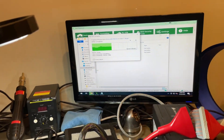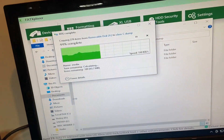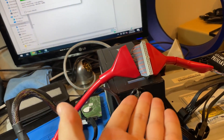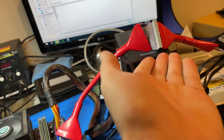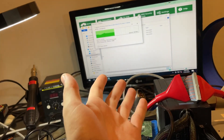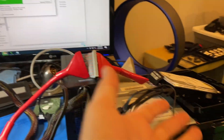But after going through it, I generally recommend that you just go on eBay, pick yourself up a $5 copy of Mech Assault and do it that way. Don't do what I did, but I'll show you how to do it anyway. I've successfully done a hot swap, which is the primary method. The issue I was having is the Linux tool requires you to have an IDE-based CD drive — it says so in the README — and I clearly don't. So I can dump the C drive at least, dump the important partitions, and see if I can come up with another option for delivering the payload.